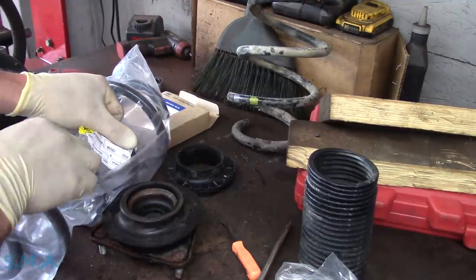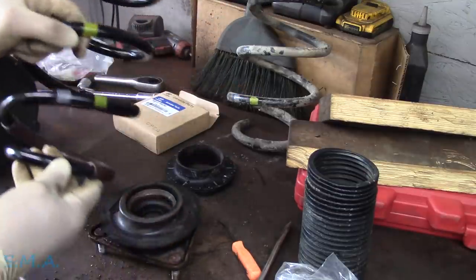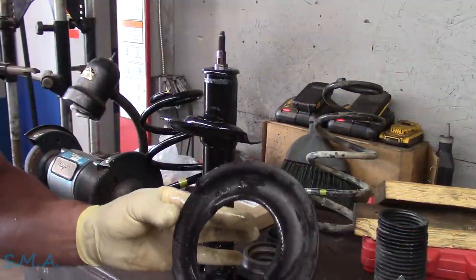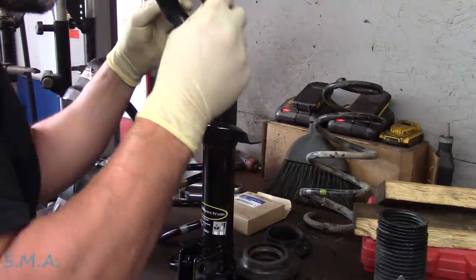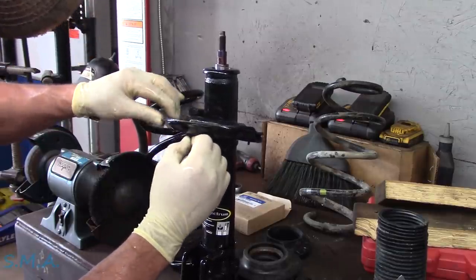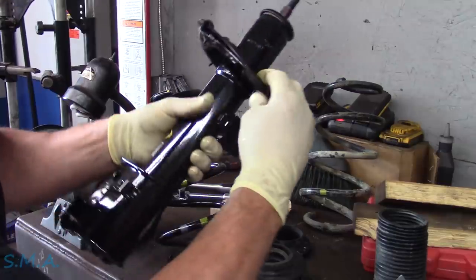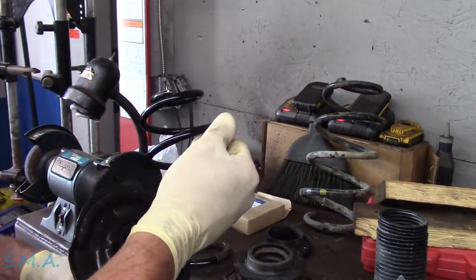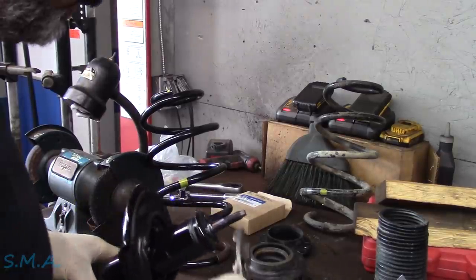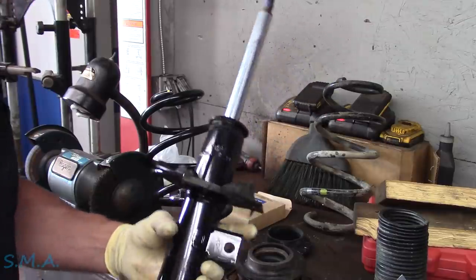Identify the top and the bottom of the spring — paint marks going at the bottom, just like the original. Let's get our new strut. The lower insulator I just took off the old strut. It's got little holes that line up — line those babies up, grab it by the nipples and make sure they pull all the way through. These ones don't have a lower retainer, so it just kind of sits on there. Boink — rub him and watch him grow, there it is, all the way out. We'll get our spring already in the strut compressor.